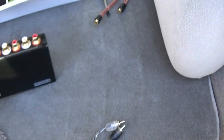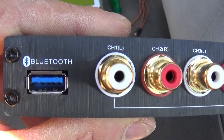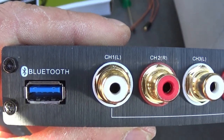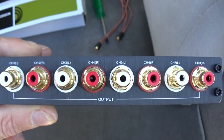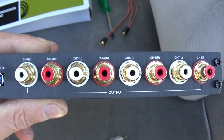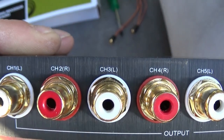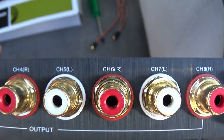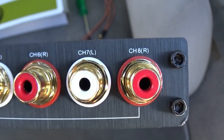So this is the other side. There's a USB 3.0 port here and I do believe that's for the Bluetooth. It says Bluetooth on it, but the Bluetooth is not built in — it's in a dongle. And then we have our eight channels of output here, guys. We're going to run channels one, two, three, and four out to the subwoofers, and then channel five and six will go off into the high amp. We're going to leave channel seven and eight open for now.